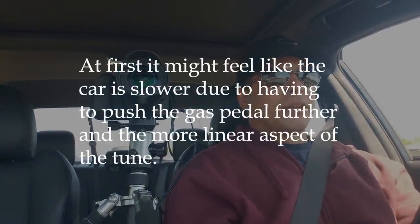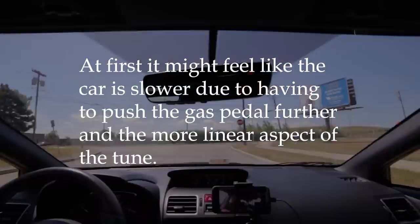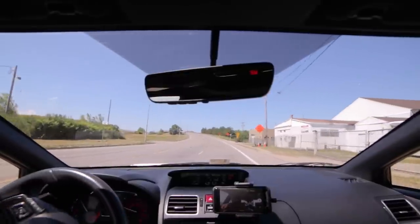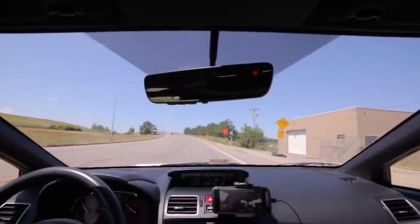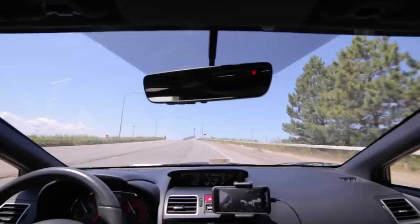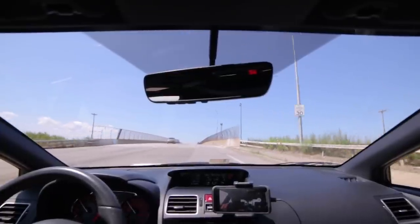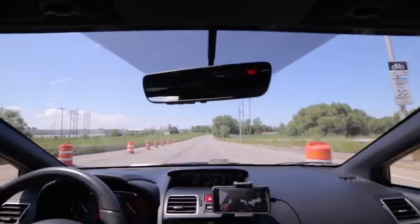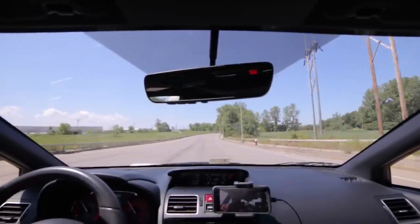In sports mode, up until you push the gas pedal 30%, the car behaves like a CVT — subdued and economical. Once you hit that 30%, the car goes into stepped mode, simulating a traditional transmission. Intelligent mode does the same thing, only up to 40%. When you combine that with the boost kick at lower RPMs and the unpredictable gas pedal, you get a jerky experience if you don't know what you're doing. Once you install the Stage 1 tune, it's only then you realize how the car could have been. It's much more pleasant and linear — zero on the gas pedal is zero, 100 is 100. You have a much more controlled and predictable boost release. The car is just much more manageable, with a very satisfying pull all the way through. That flat spot right after 4,000 RPMs is kind of gone — before the car would feel like it slowed down a bit after 4,000 RPM, but now it just pulls all the way through.